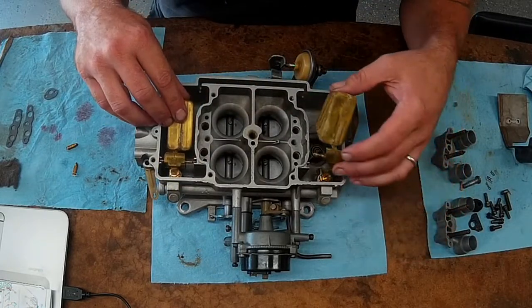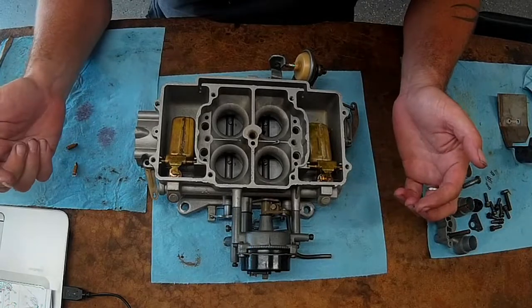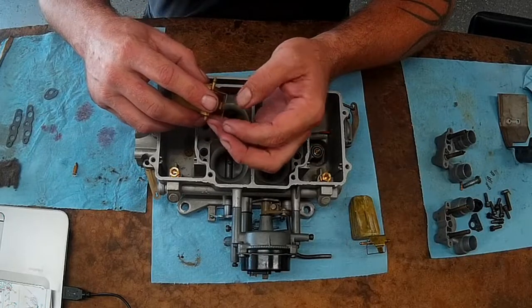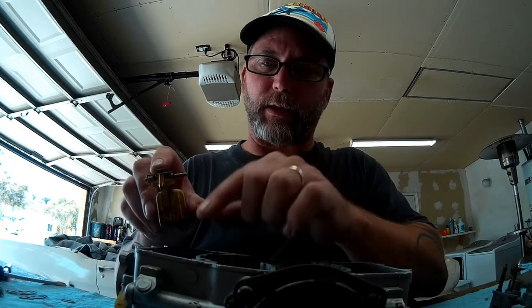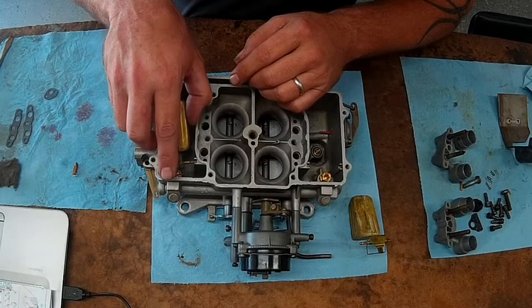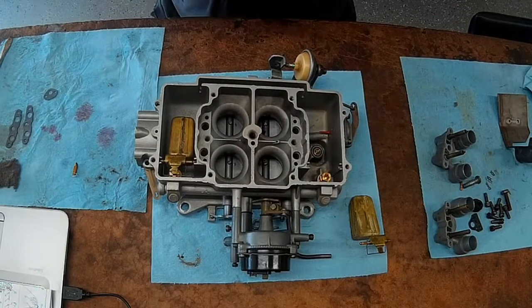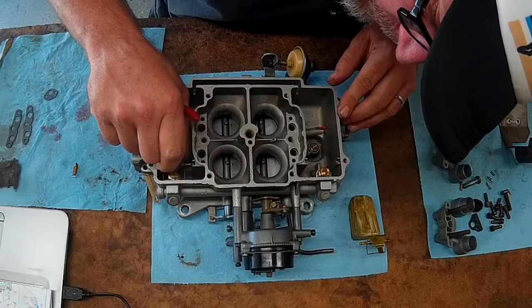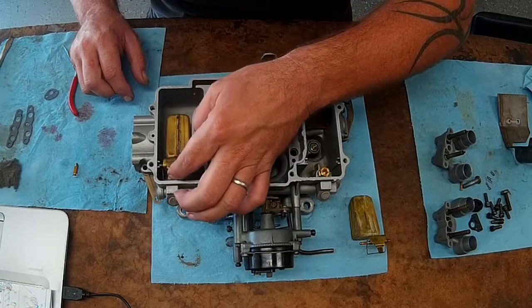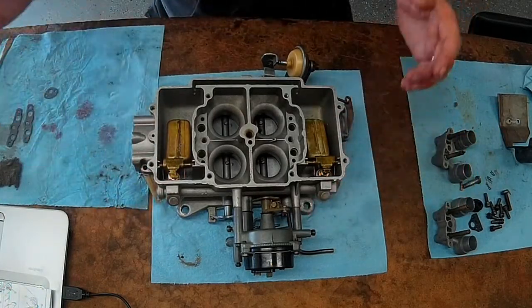I've put the pins back in the same way they came out — I pulled the pins out of the float bodies and took some steel wool to them so they pivot nice and freely. We've tested the floats to make sure they actually float. Note that the float jet is offset to one side of the carburetor body — offset to the outer limits of the body — so your pin has to be offset as well. If you keep the pins in place when you remove the floats, you'll be sure to get them back in correctly. Put your needles in place — the needle just hangs on the tang — with your clip on the outside so you can clip it onto the float jet. Drop it into its jet and push your clip down into position.